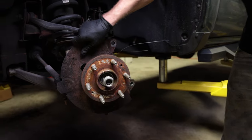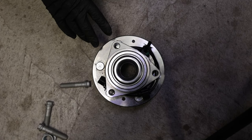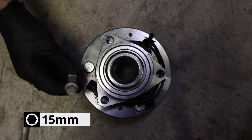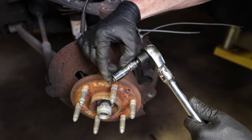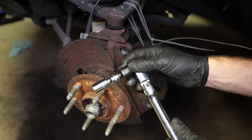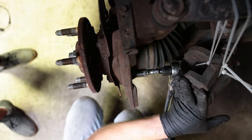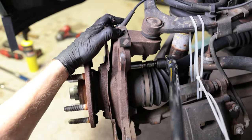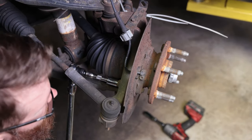In hindsight, I would have gotten new brake dust covers, but I did not get them so we will be reusing these rusty ones. There are three bolts holding the hub in place — they're all 15 millimeters. Because the axle kind of gets in the way, I found the best combination is a short 3/8-inch 15-millimeter socket going into a short extension, then sizing up to half-inch for a little more leverage — though you could use a long breaker bar as well. You can throw a little heat on these if you want. And this is where having the whole front end off the ground really helps, because we were able to turn the wheel to the left and have a lot more access to that third bolt.